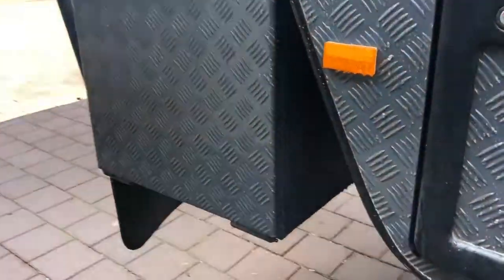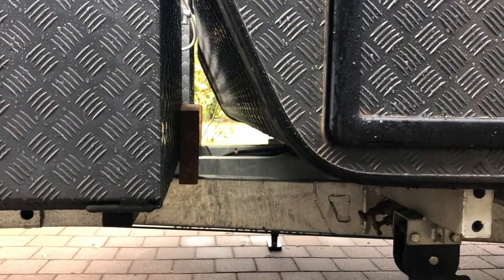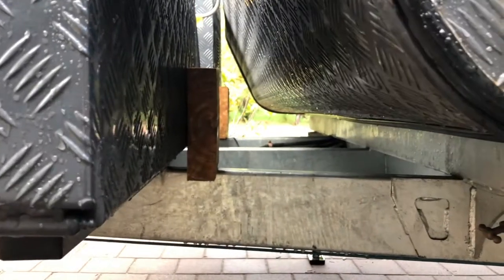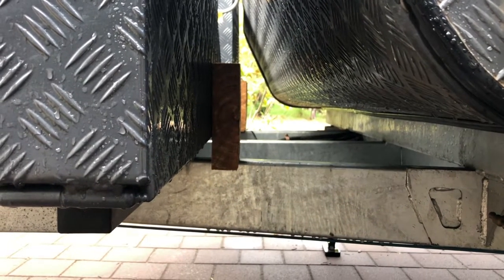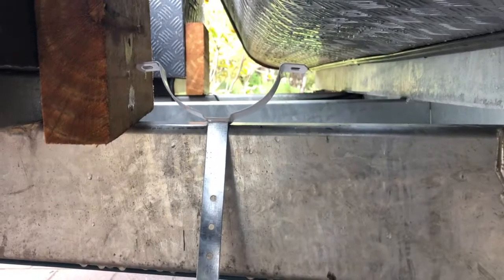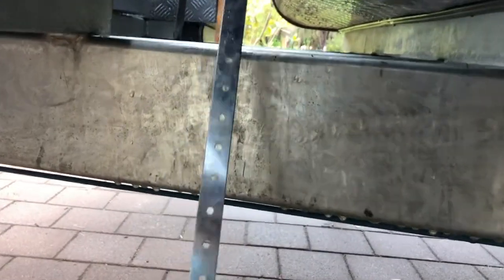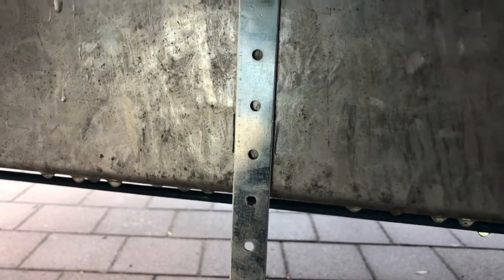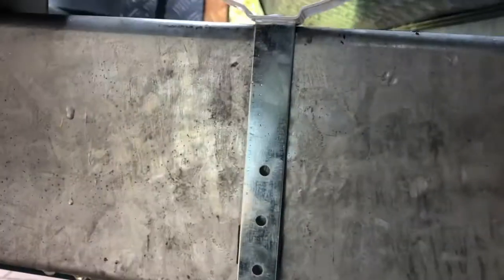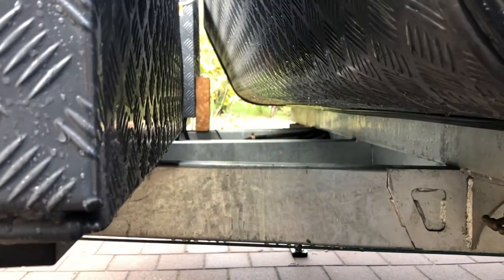There are a few places where you can put the fishing rod holder. For me it's in between the tunnel boot and the cab of the caravan, next to the toolboxes. I've already cut it to size and put the PVC pipe in there. The chocks are there just to give a bit of gap between the boxes and the PVC pipe. Next, you want to measure out your clamps — they're very long and drop down past the frame. I've put two marks on either side so I can get it leveled, then I'll cut the hanging clamp to size and install it on both sides.